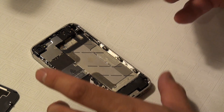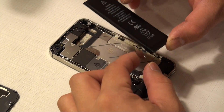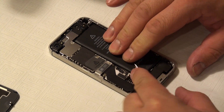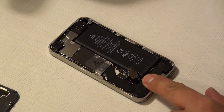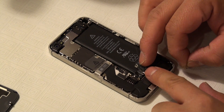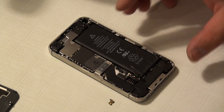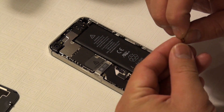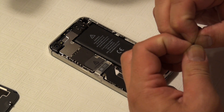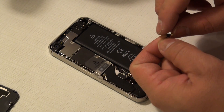To reinstall our battery, we literally do it in the exact reverse order by carefully dropping our new battery into the battery area, making sure that our ribbon cable is not being pinched too badly. Before we press the battery connector onto the logic board, take the little spring ground connector and bend up the little end point with your fingers just a tiny amount — just enough to give it a little more springiness.